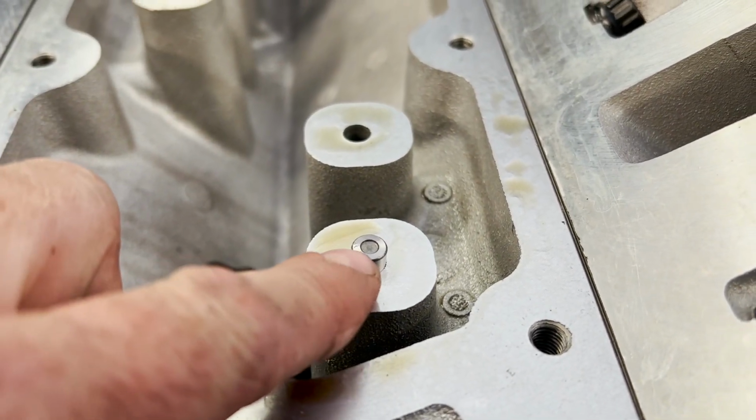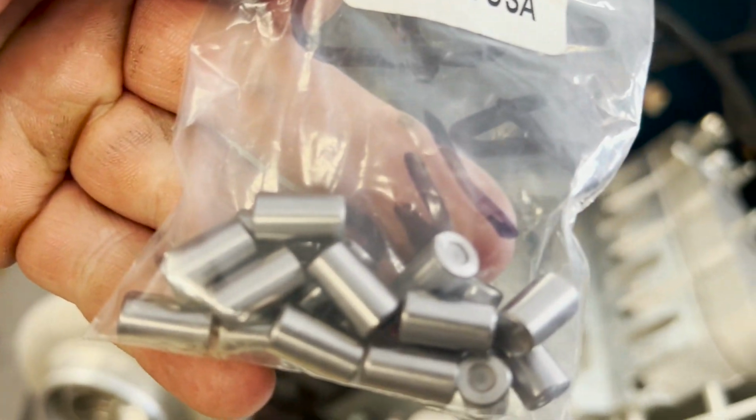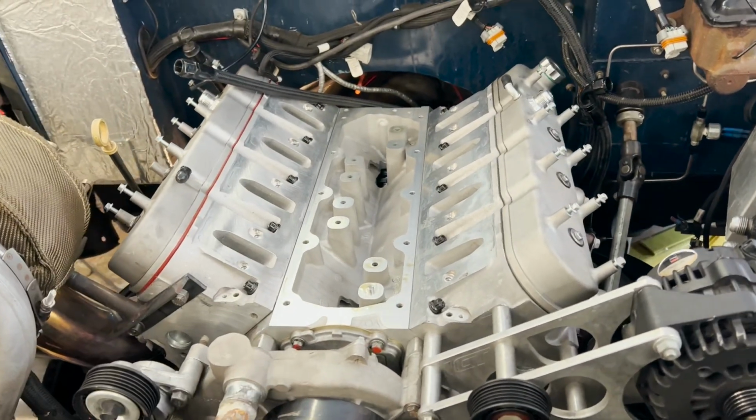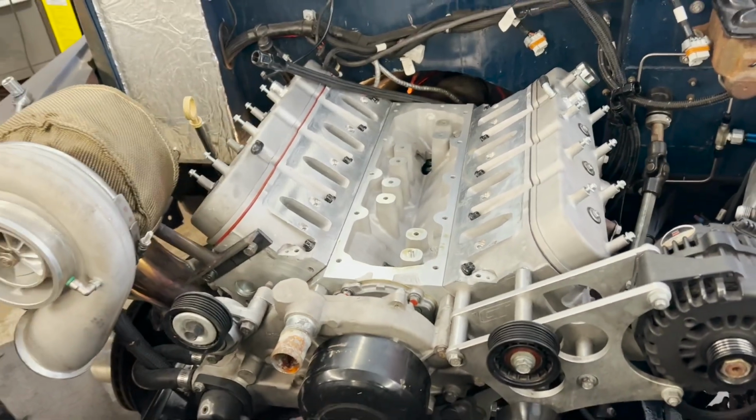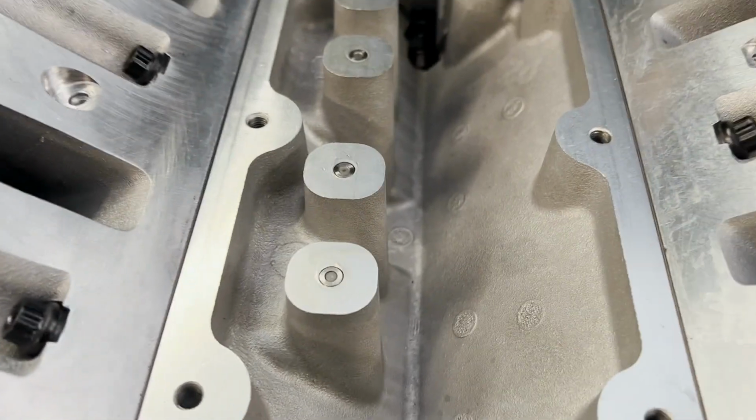And you'll do it with these little dimples here facing up, because the bearing itself, the roller is actually tapered. So that's the way you want to do it, with the little dimples facing up. So I'll grab my punch and a hammer, knock those in, and I'll show you what they look like when they're installed. We got them all tapped in, flush,